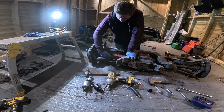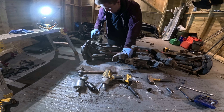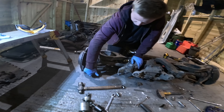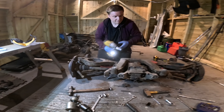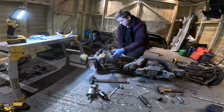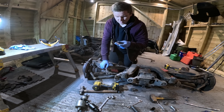You've got these mounts here - a little aluminium arm that joins the anti-roll bar to the spring perch. Virtually every single subframe, these are rotten. You can usually get the bolt to spin a couple of turns and then it seizes. I'm not even going to bother - I'll just hit the aluminium arm and snap it off. You can never reuse these; they're impossible to salvage. The whole arms are about fifteen quid each for a pair on my website - it's just not worth messing around with them.